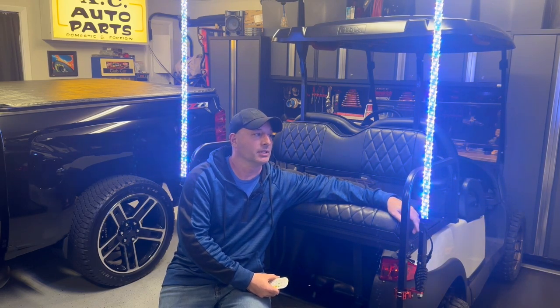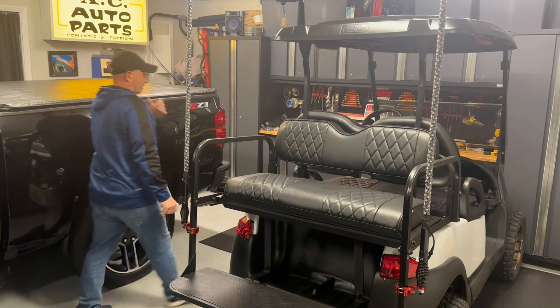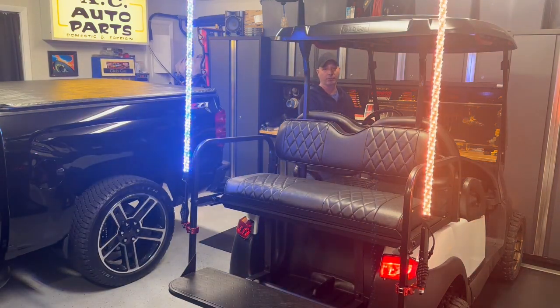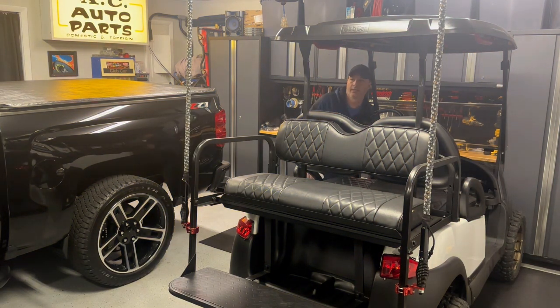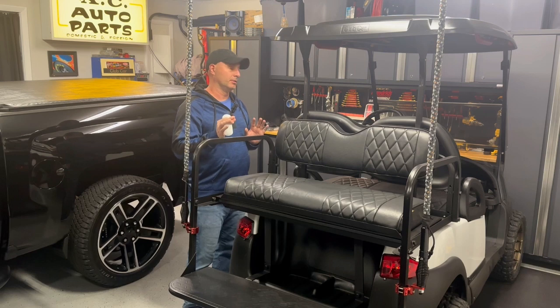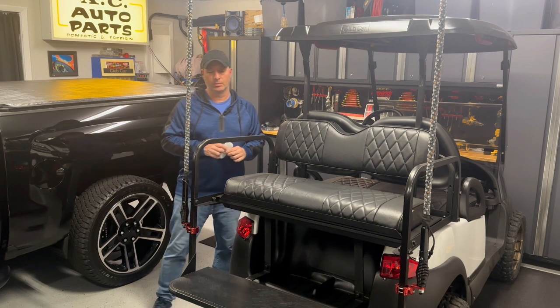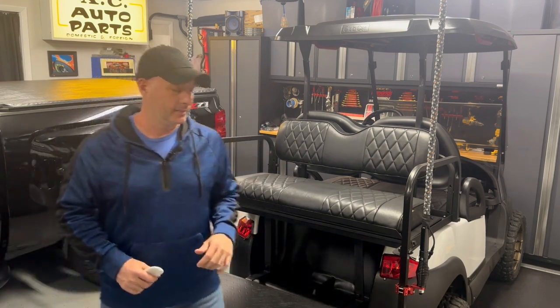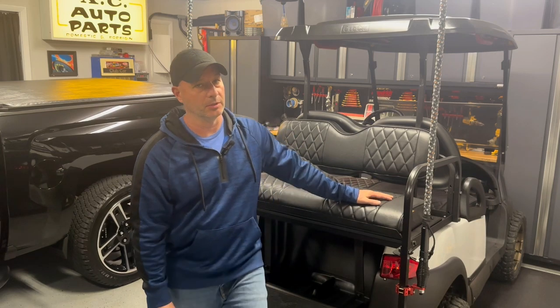One thing that I am seeing with these, even when we do turn them off, when you do go to use your brake pedal or your signals, they still will be on and they still will function. So that's one weird little thing. So they do shut back off, but they are getting power from the system when you hit those controls. So if you do want to wire them up to your brake lights, your signal lights, that looks like it will continue because they're receiving power from the light kit, the Precedence kit, not necessarily the controller from the whips. So something to be careful of.